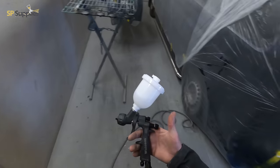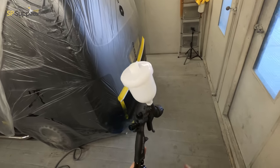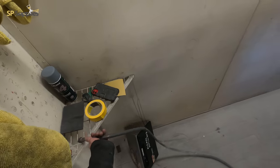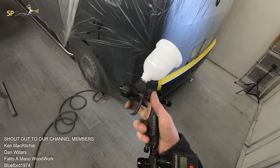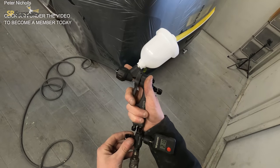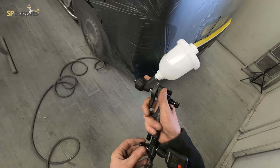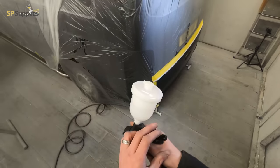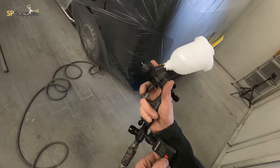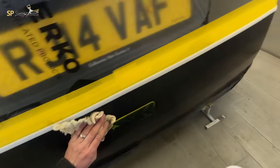For clear coat I'm going to be using the Walcom Ego Carbonio — it's the HTE 1.2, the Ego 190, which is basically their minigun. Personally I found this best running at around two to two and a half bar. Running it at two and a half bar it felt like it sprayed like a big gun, even though this is a minigun with a small size pot — as you can tell, I'm one-finger triggering it. But it is an extremely powerful small gun in my opinion.